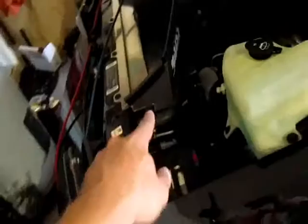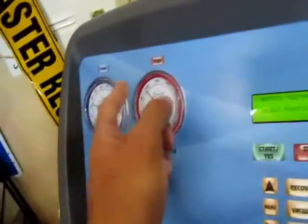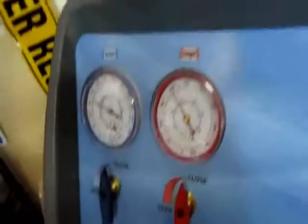Ideally I could probably tune this car so the secondary fan kicks on sooner based on the pressures in the system, to keep that high side pressure from getting that high in the first place. I could probably program the secondary fan to kick on at maybe 225-230 PSI instead of 250. I should change that.